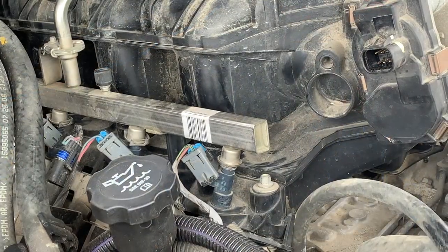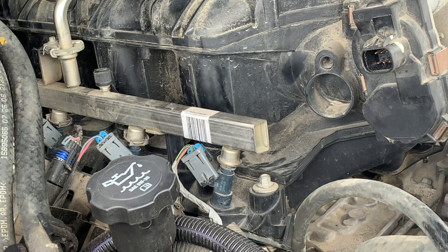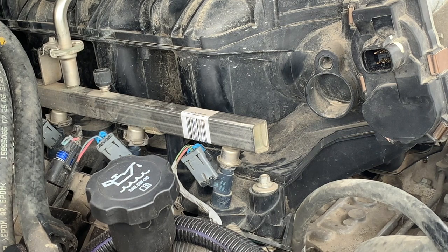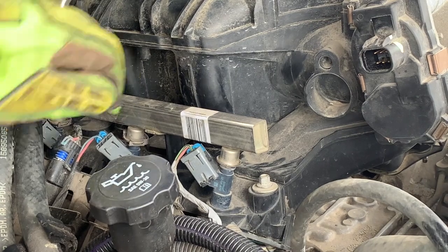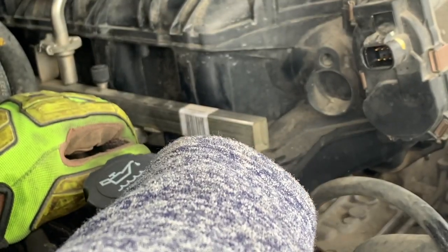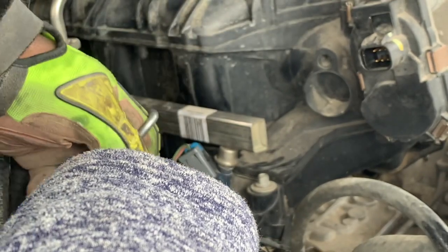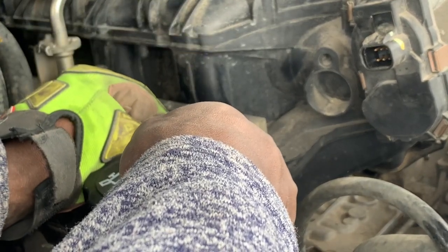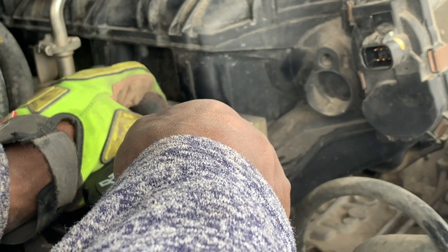I hope you'll appreciate this because the harnesses on this injector gave me some challenges, but I figured it out and I'm going to show you. Depending on how old the vehicle is, it may not have this retainer clip — there's a black retainer clip where I'm touching on the injector. Sometimes your vehicle only has the gray one, which is easy: you just press the little gray tab on the bottom and pull out.